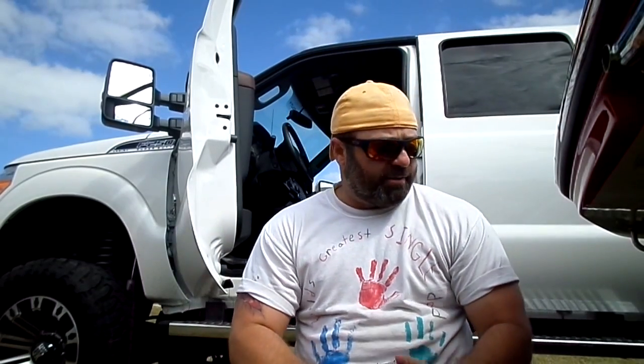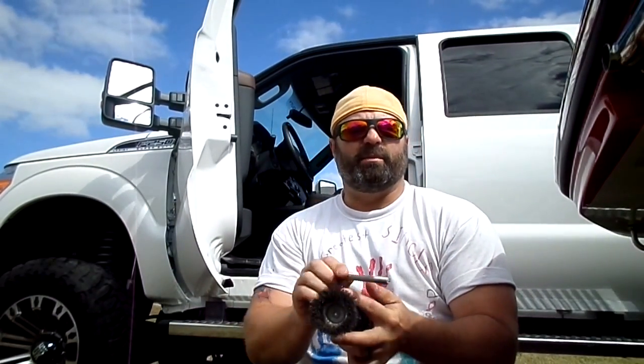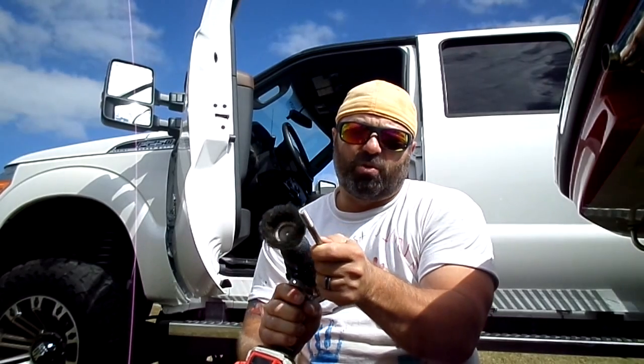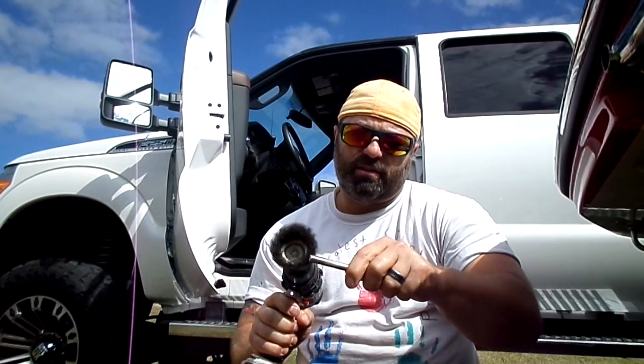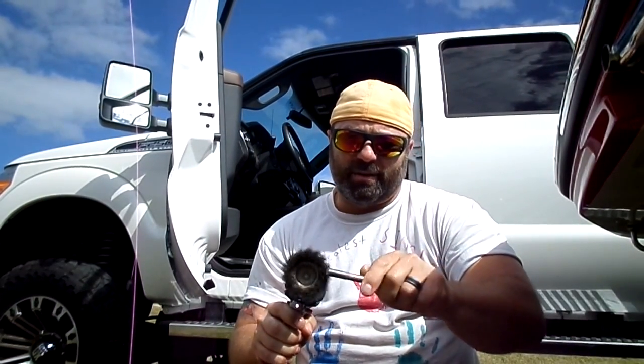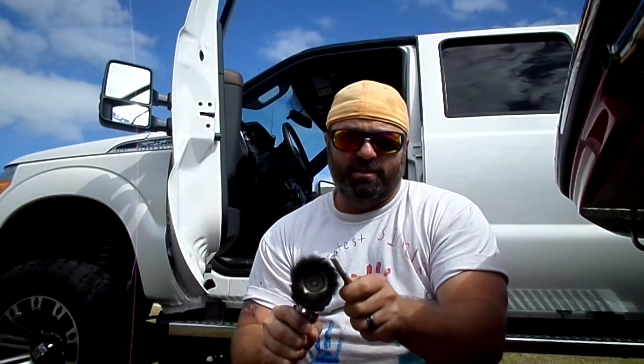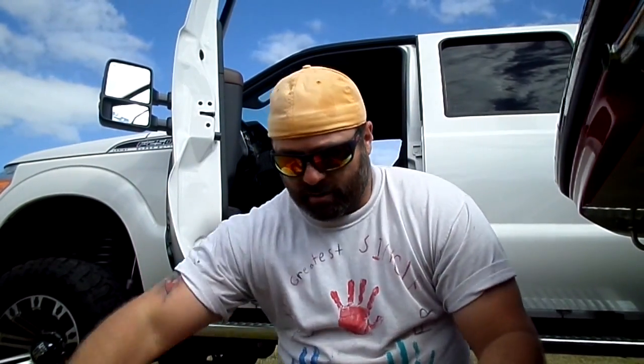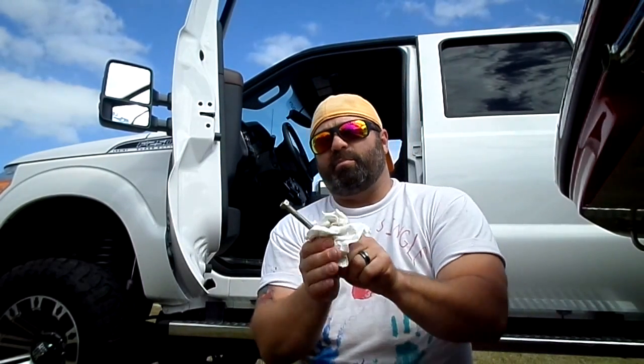Okay, I'm back. Now, these bolts, remember I said clean them off. I just use a drill with a wire brush and go around to clean out those threads. It's really that easy. Nothing too scientific. And that's it. Just paper towel, get all the rest of the crap off.